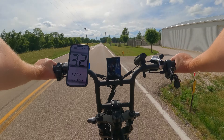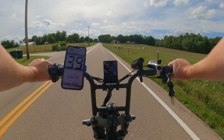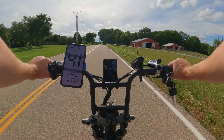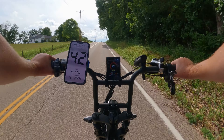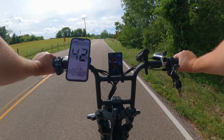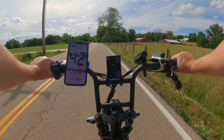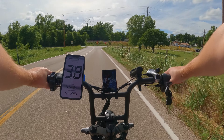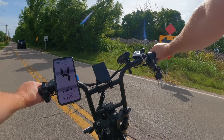Let's see what we can get up to. It definitely feels like it's faster with these two batteries — I'm not even joking about that. It's got a higher top speed, which makes sense. I've never gotten a 43 there with a single battery. Now, I do have to mention this because I've figured it out and I'm not the only one having this issue — the display is very inaccurate. You have to power off the bike and power it back on for the percentage to update, which means some of my tests might have been skewed a little bit.